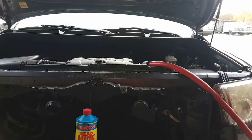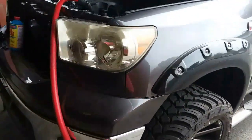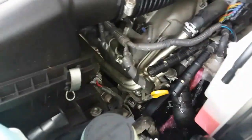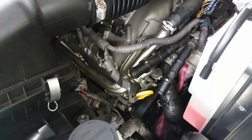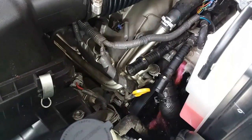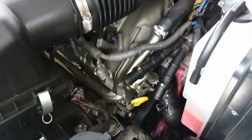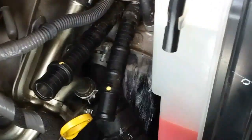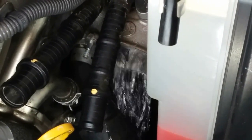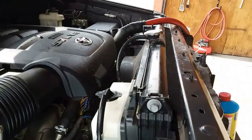So let's go ahead and flush out the engine. Turn on our water — not a lot, just enough. And over here it's already draining from where the thermostat housing goes. So you can see all that pink stuff. We're going to wait until it runs clear. Looks pretty clear to me.